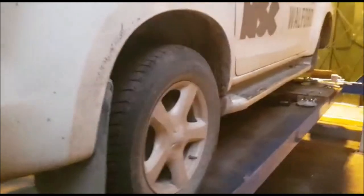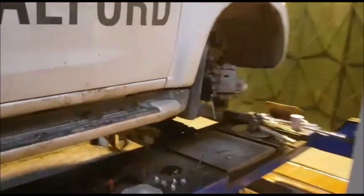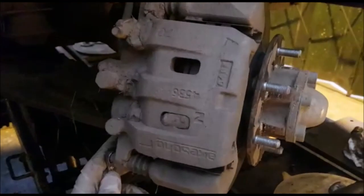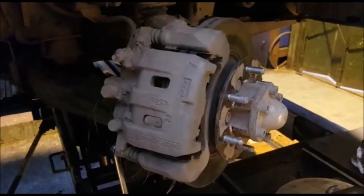Front brakes on an Isuzu D-MAX 2016 — they've just been hammered and gone right through to metal-to-metal on one side. The other side not so much, so I'm just doing these to match. To start with, it's 12mm caliper retaining bolts, and as I go through I'll tell you the rest.